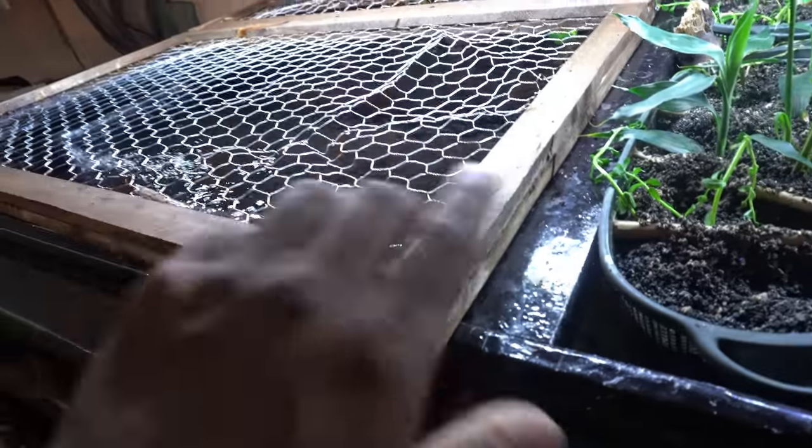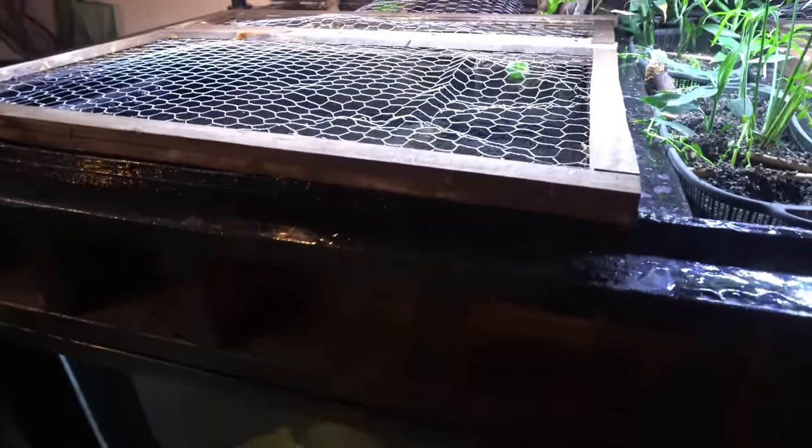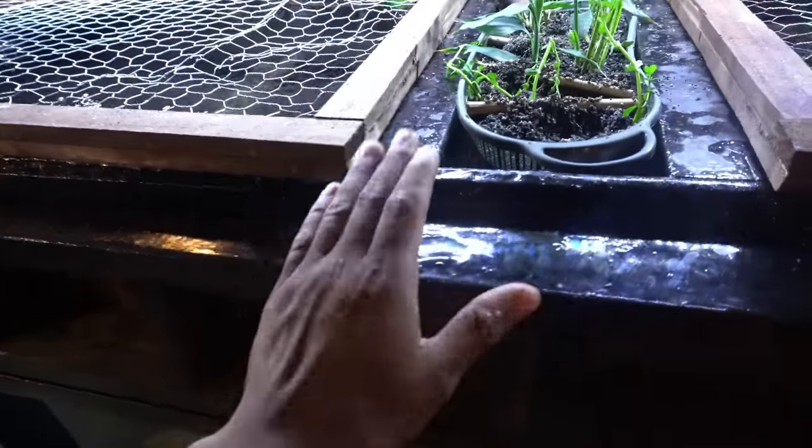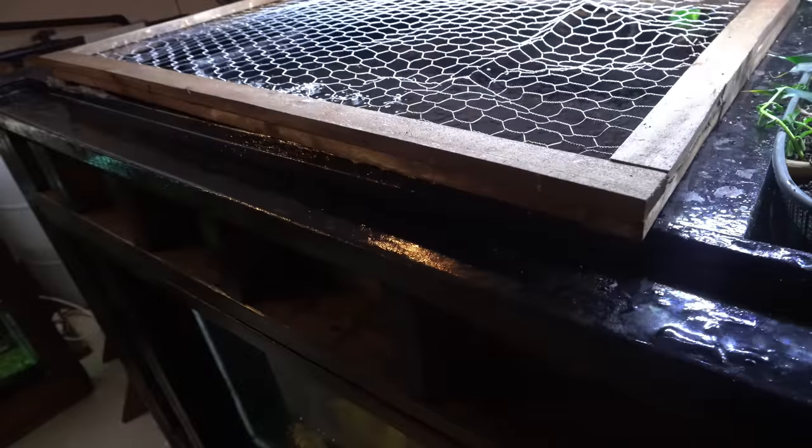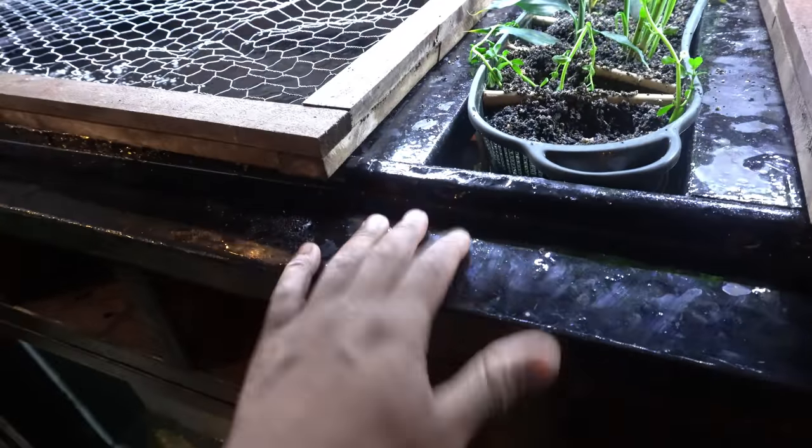After that, we decided to use fiberglass cloth all over. Originally, we were just going to do fiberglass cloth for the seams, but I ended up buying 150 yards of that cloth because that was all available, and we decided to go ahead and just do the entire body since I had so much of it. That same fiberglass cloth is used to repair boats and things like that, so of course that is the stronger way to go. A little bit more expensive, but once again, peace of mind.